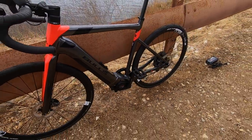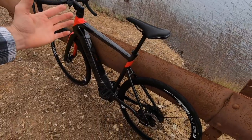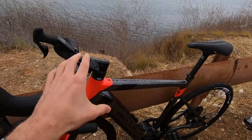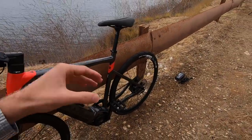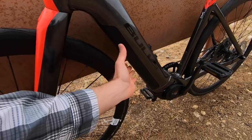You can see down here this is the Bosch Performance Line Speed fourth generation motor — just 6.3 pounds, which is amazing. The old Performance Line Speed is 8.8 pounds, so that's a significant weight difference. The total bike weight is 41.5 pounds for what you see here. I mentioned this is not a carbon fiber frame — it's aluminum alloy, maybe a little bit more durable. At higher speeds up to 28 miles per hour supported by that motor, it feels pretty steady. There's definitely some more weight here than a traditional road bike.